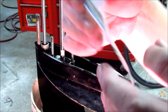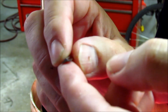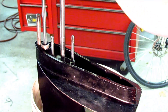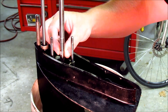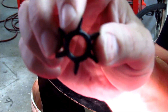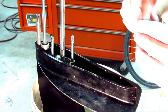There's the new keyway key — there's a part number there. I picked this up from my local Mercury dealer. Just a little tiny guy. It has a little key section on top and a concave section on the back to fit around the shaft. On your shaft you'll have an empty spot — use some grease, place it in there. The grease will basically hold it in place, and then your impeller can fit down on it in its key section. That has to be in there or else the shaft will just spin and the engine will overheat.